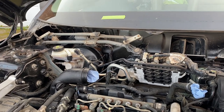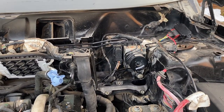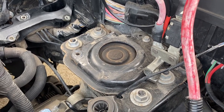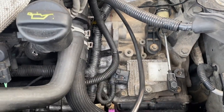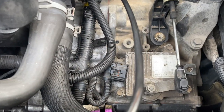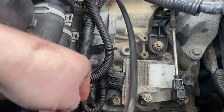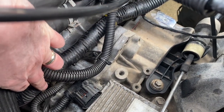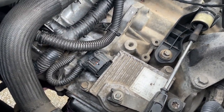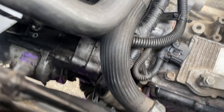This is now with the rear panel removed, the air intake pipework removed, and the battery tray removed - which also gives us access to the hanger for the gearbox. The next stage is to remove the starter motor, which is tucked down under those wiring looms. We need to get these wiring looms out of the way in order to get to the bolts holding the starter motor on, which are tucked behind these cables and towards the bottom of the engine bay below the starter motor.